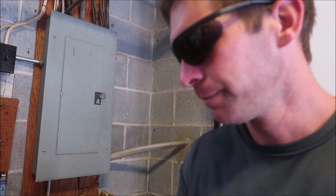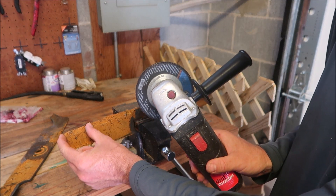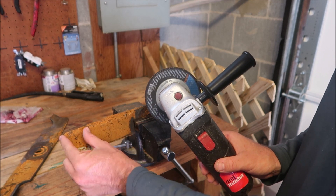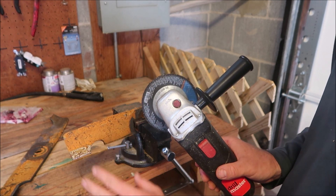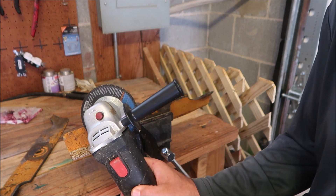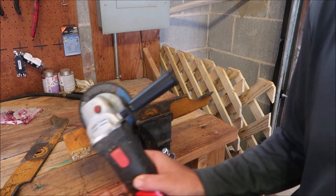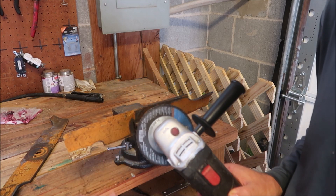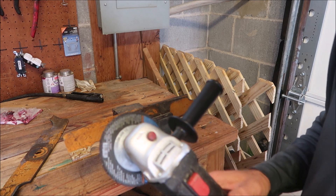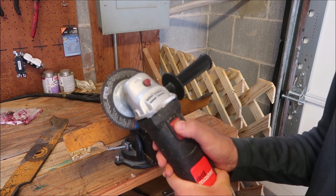Let me show you how to do it. I'm focused on that outer portion of the blade — I might just touch that up a little bit. A normal blade wouldn't have the rust on it, but I'm really just using the outer edge of the grinder and going to try to keep that same angle on the blade that was already there, and just make it sharper without taking off much metal. Let me show you how easy it is.